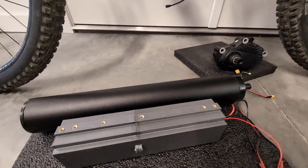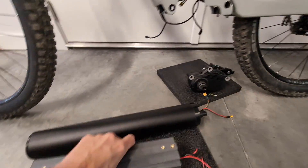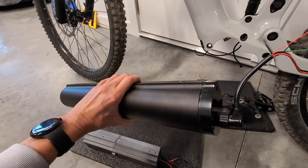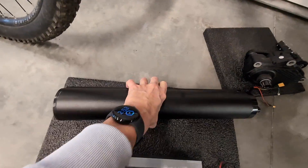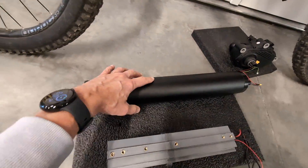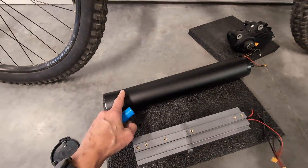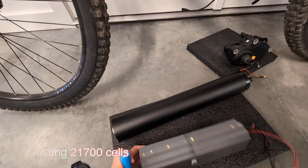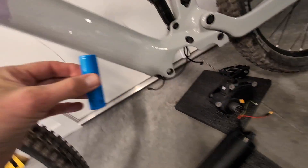So I built my own battery — this is my own concoction here — and I'm going to guide you through how I built it. I'll have links to all the parts and all the 3D print files, and you can save five pounds by doing this, so the bike now weighs under 40 pounds. The 720 watt-hour battery comes in an aluminum case that weighs a lot and uses high-quality Samsung 21700 cells oriented lengthwise. My build is essentially half that — 360 watt hours — using half the cells in an up-and-down orientation, and it actually fits better than the OEM battery.